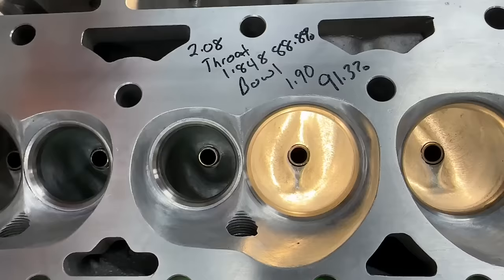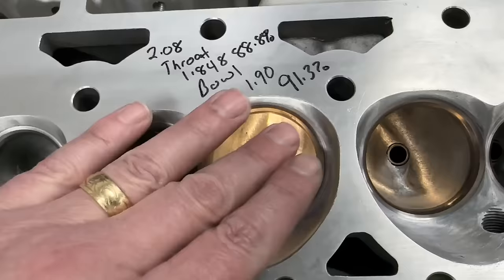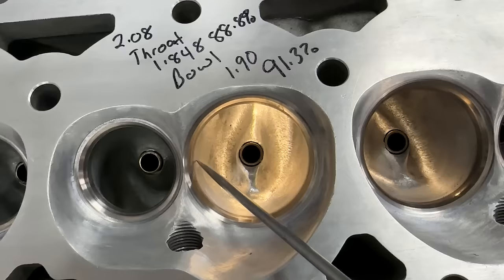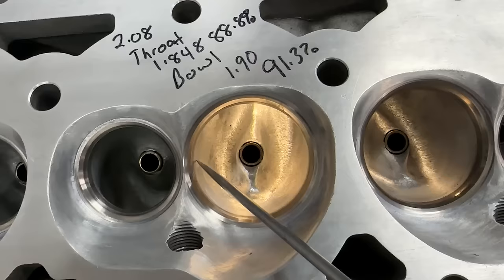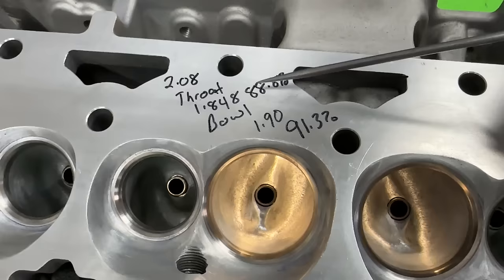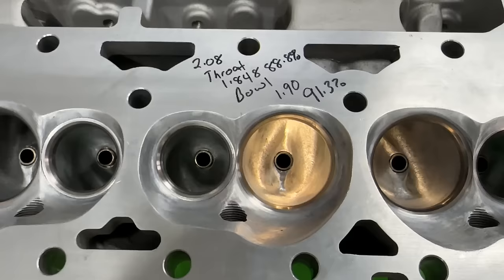One of the things I like to do is take some measurements and compare them. We'll start with the intake port. The most important thing is the throat - I measured that. With a 208 intake valve, the throat itself, measured from the smallest section right through here, came up with 1.848 inches, which is 88.8% of the valve. To do that math: take the throat, divide it by the valve diameter, and that's your percent. In general, 90% is safe. If you go over 90%, you better know what you're doing. For most DIY guys watching this, do not go over 90%.